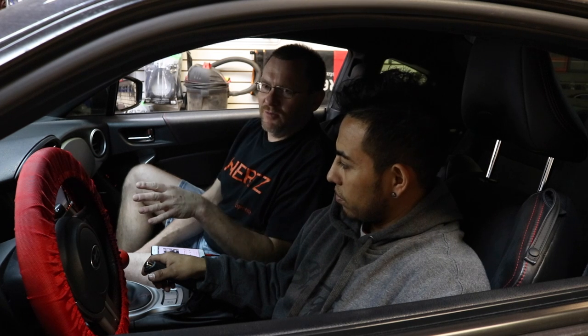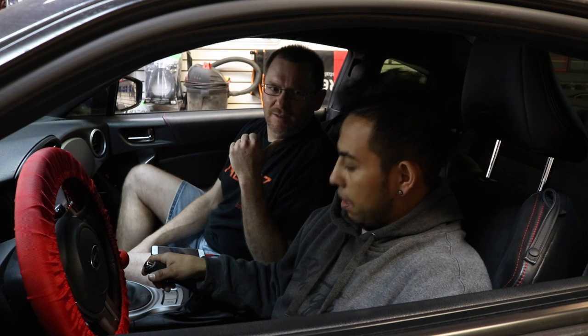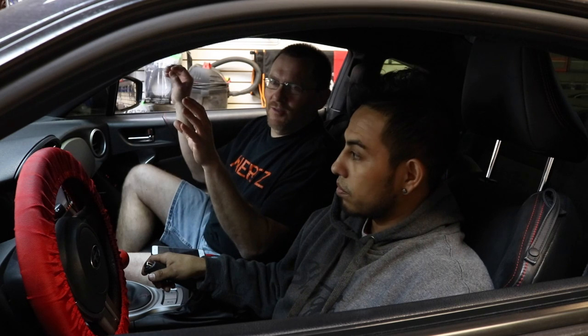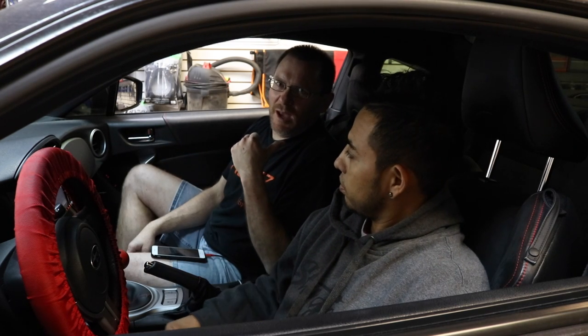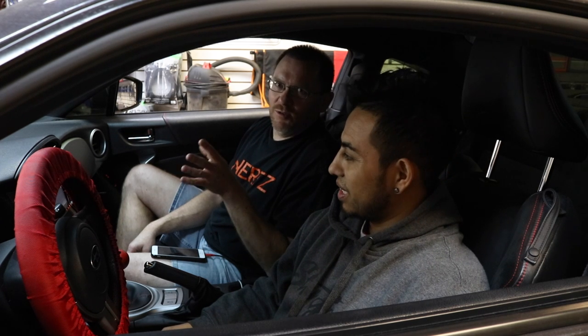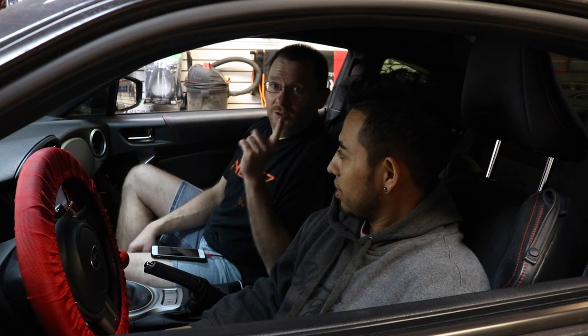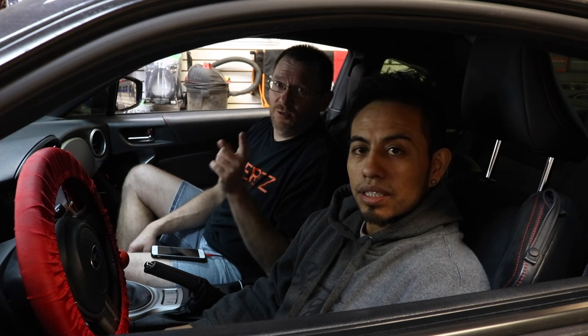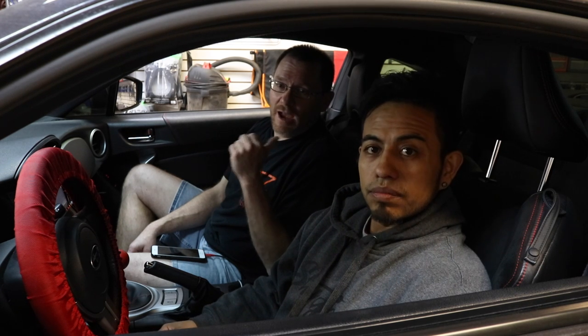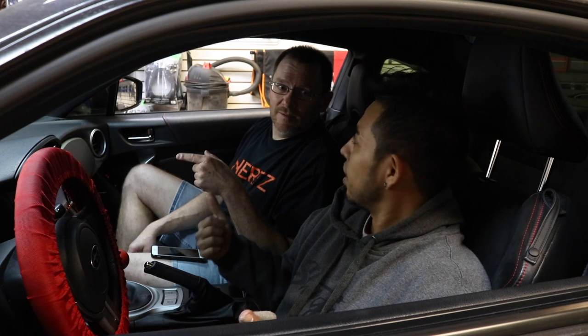Amazing. So just to recap real quick, what we got here is a Pioneer 4800, some Hertz High Energies. He's got a matte sub, that's a 12. Alpine PDX V9. It is in network mode, so we have full active front. There's no rears in this bad boy because from the factory it's just four, so those are useless, no reason to put those in. We took out those power hungry passive crossover networks that he didn't even need in the first place. Because the one thing about a PDX V9 is you can actually run the amp in network mode too. The front channels have a 10 times multiplier, so you can go full active from the amp or from the radio.